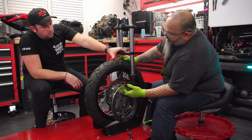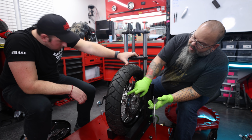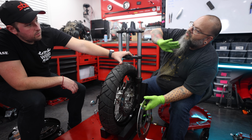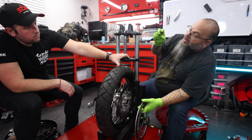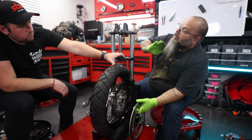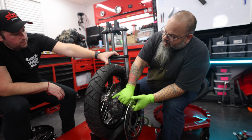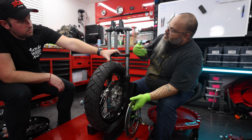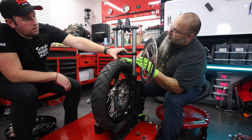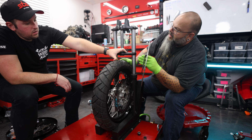And that's really all it is. Like, your rotor on the WR has this wave style in it. Right. What that does is where it's cut down, when it comes through the brake pads, as you're on the brakes and the rotor comes through, that's like a leading edge. So it bites harder. Oh, okay. As it runs through, and then the holes in everything help dissipate heat. Okay. Now this one is cross-drilled to help dissipate heat, but there's no wave to it to help it bite into the brake.